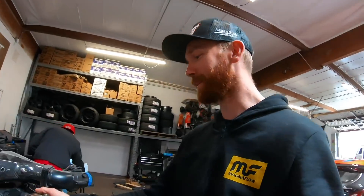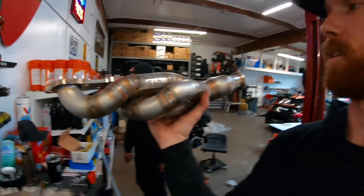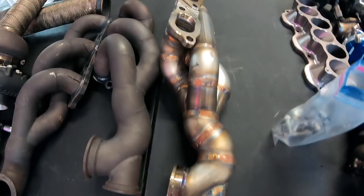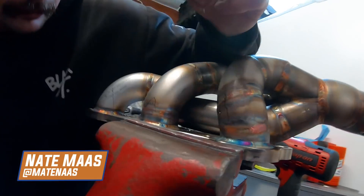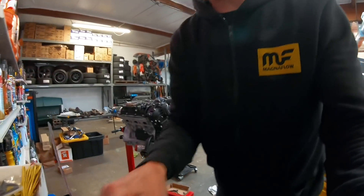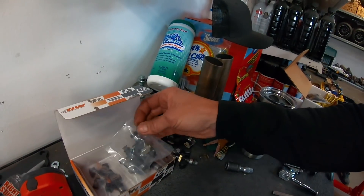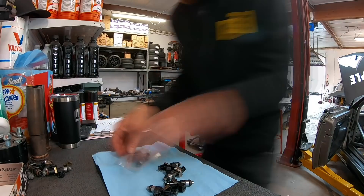This build will be done by SEMA - it has to be done by SEMA. Brand new manifolds from Diamond Fab - D-Rick just showed up. These are schedule 10 versus schedule 40 - the old ones. There's our old manifolds right there. New ones will look just as dirty as those shortly. We were just mocking up for our new EGT sensors, which we are going to get punched through, getting old Nate dog on the manifolds. We found the two rails - I gotta put some new o-rings on the injectors. These are the old ones - we're going to box these up and ship them out to be cleaned up for our spares.